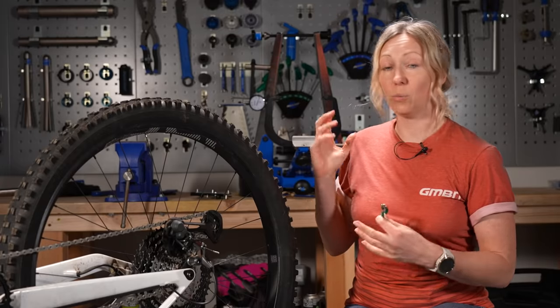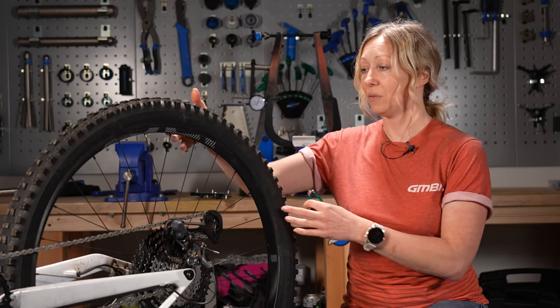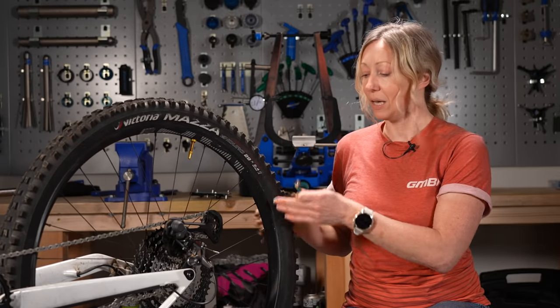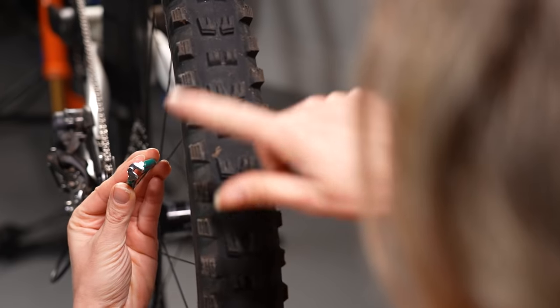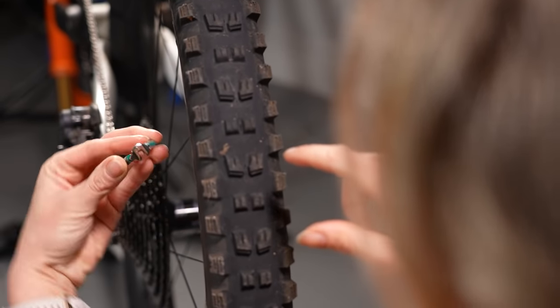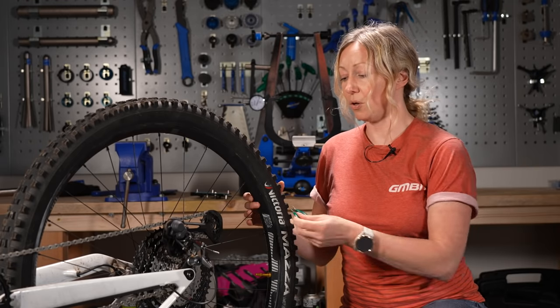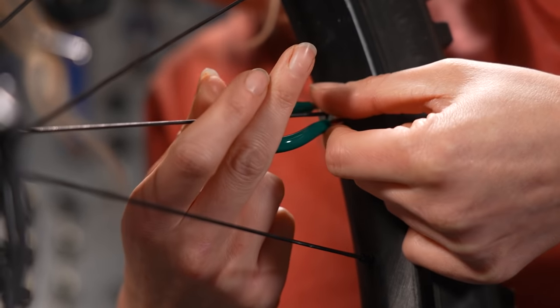Without a professional wheel building jig, the best thing to do is to turn your bike upside down because you can spin your wheel and see whether it's straight, and you can also work on any of the nipples that are loose. It's also good to look down at the tire because the righty-tighty method is going to work when you're looking down at it — basically a nipple is like a bolt that screws onto the spoke. So in order to tighten it up, it will be clockwise as you're looking at it down towards the hub.